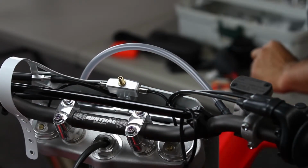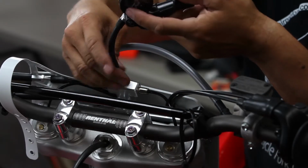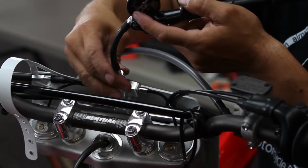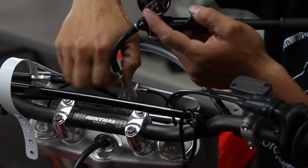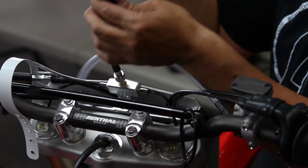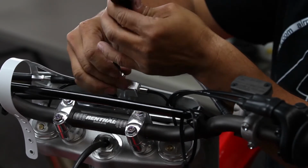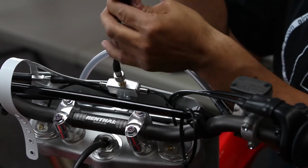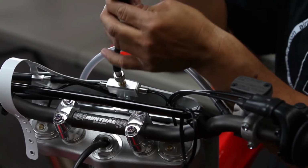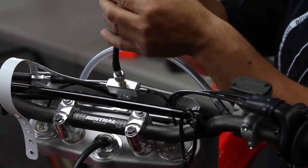The last and final step is, of course, put air in it. And you can use a low pressure bicycle pump or whatever. It'll work fine. You just don't want to use compressed air to pump it up. And so simply pump it up to your desired level. Fast riders prefer 32 to 36, depending on weight and conditions and that type of thing. So you pump it up.